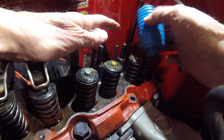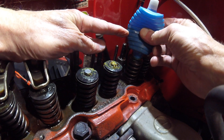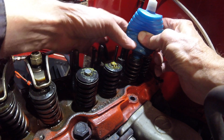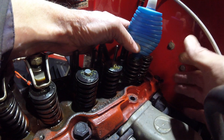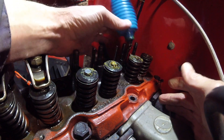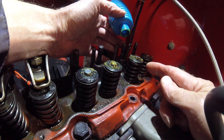Check this back one here — same thing, got some grease around it, press it on there good, hold it on there nice and tight, release it — it does not hold a vacuum. You can also see oil coming up, so that has a bad seal.